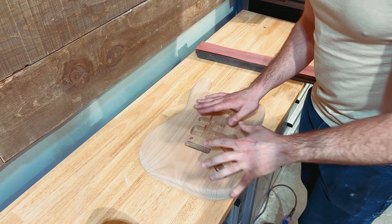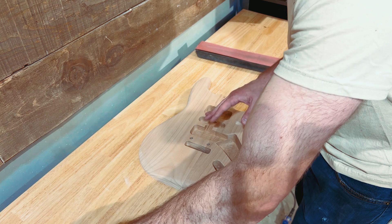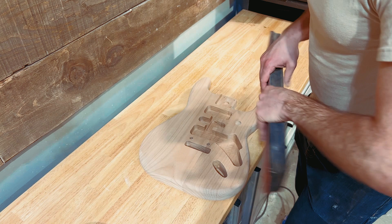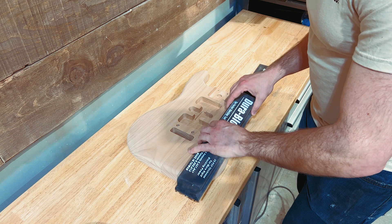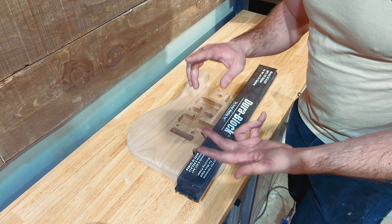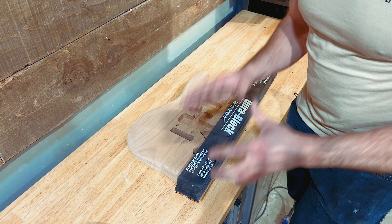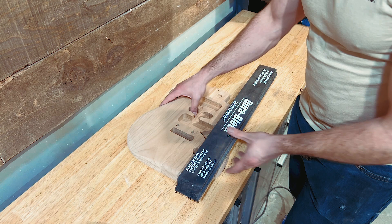Please note if you're relatively new to sanding: don't start the sander in the air — if you put it down that way, you can leave swirl marks. Hand sanding is safer and easier. This is faster, which is why I'm doing it. Just using what comes in the kit is the safer way of doing it. Also, I'm starting at 220 and then moving up to 320 because of how smooth this is. But if you're starting with a rougher body, you actually want to start at like 120, then go 150, then 220 or 180 even, then 220, then 320. Don't jump right to 220. That's not how you're supposed to do it. And don't just jump from 120 all the way to 320 — you'll leave scratches that the 320 won't take out. Work your way through the grits. You will not regret it.